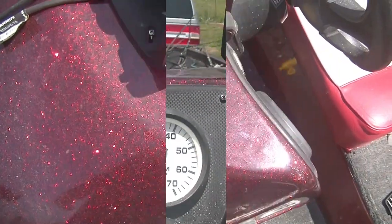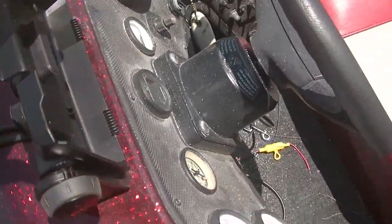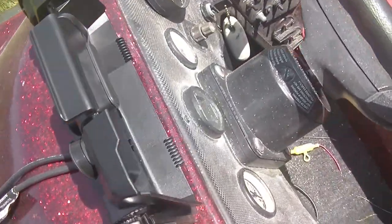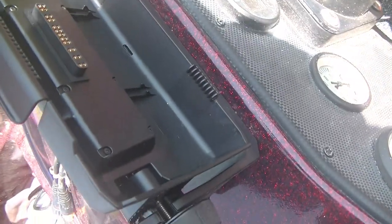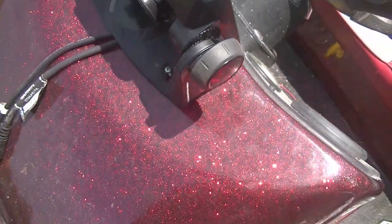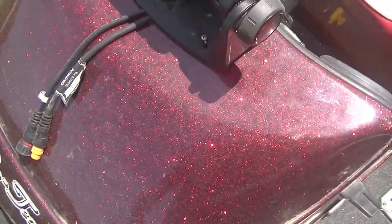Because we're trying to save money at this endeavor, not cost us more money. This backing plate that the depth finder actually clips into is kind of a new deal to me - I've never seen that. It makes sure it aligns with the power right off the bat. You've got a plug protector that comes across the top that you just get out of the way. If you want to take the depth finder out of the boat, make sure and cover that back up because water's bad on that kind of stuff. That's in place - good and sturdy.